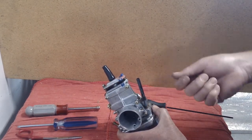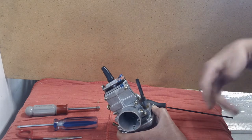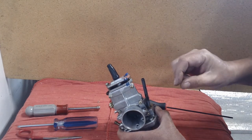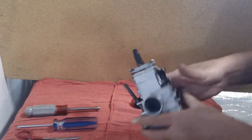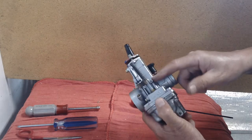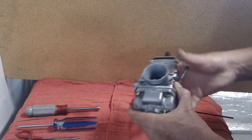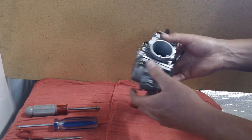If you're not sure which way to adjust the air screw, turn it in a quarter turn — that gives you more fuel-to-air ratio, richening up the carb. If you make a quarter-turn change on the stand and don't notice a difference, set it back and go do more driving to fine-tune by feel. Components covered so far: fuel inlet, fuel outlet, vent lines, idle screw, choke, air screw. Also, the overflow nipple on this carburetor is plugged on the inside — we'll get to that in a moment.